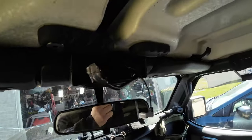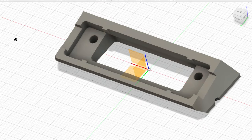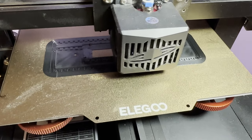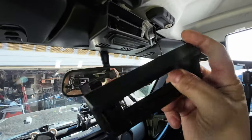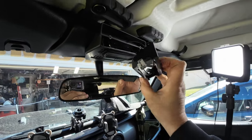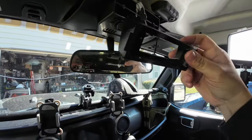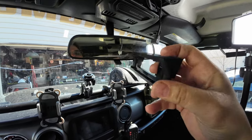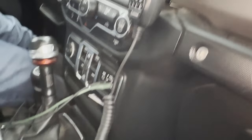We got the radio all in there - it's under the back seat. I've still got to tie up some of the wires and get the face panel in. Some of the first face plates I made struggled with the latches, so we printed a bezel that'll tuck the wire in on one side for the mic and the unit connection in the back. The face plate will angle down just a little bit so you can see everything. This'll be available for Patreon followers - just print it off, it's PETG. We put the mic mount in the side of the center console, just drilled that.